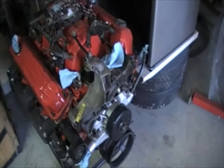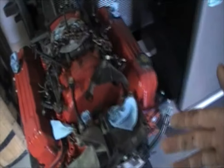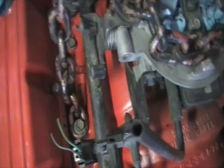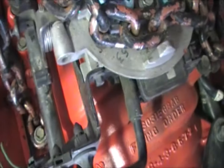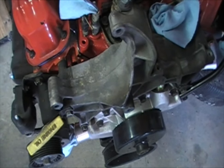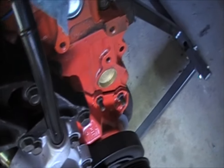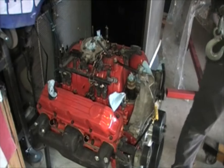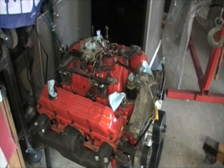When you're hooking up your motor to a chain or whatever, you're going to want to hook up to something that's usually connected to the heads. I've found that intake manifold bolts work just fine. Sometimes these accessory bolts on the front of the heads are also a good place to hook up to. On the driver side head, you've got a bunch of open bolt holes. Just make sure you use grade 8 bolts and you should be good to go.